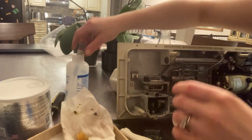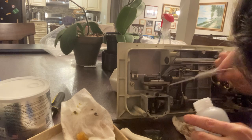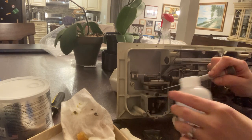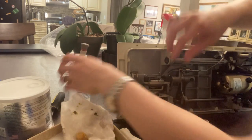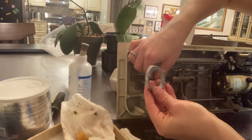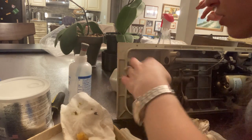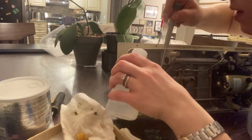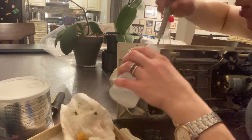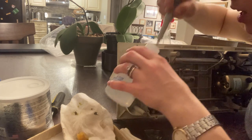Let's move on to oiling. I am going to oil by the hook. You also want to remove the hook housing — you want to remove all these, because if anything is jammed it could very well be in this area. That's kind of an easy fix — if there's a thread in there, just remove that first before you start freaking out and trying to oil.